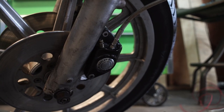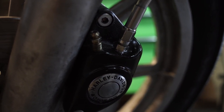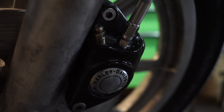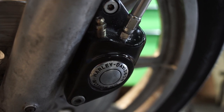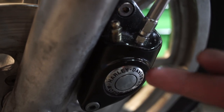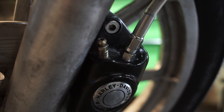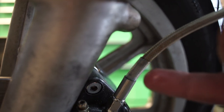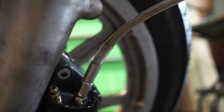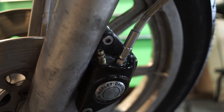So I went to bleed the brakes on this thing. See if the camera will focus closely — it is wet right there on that caliper. My finger is wet, and that's just from pumping the front brake lever. It looks like it's actually coming from higher up than that, and it's wet up here on that brake hose as well. So it looks like I need to replace that brake hose before I can finally try and bleed these brakes.